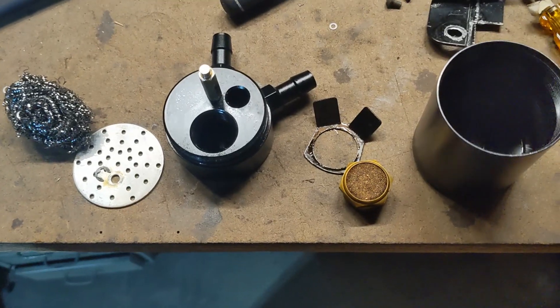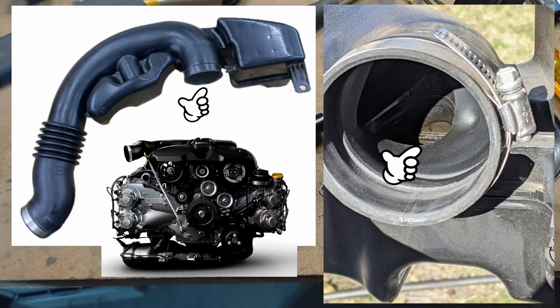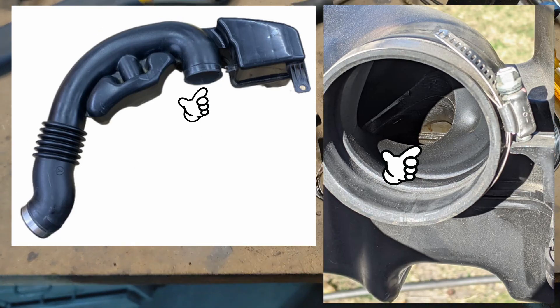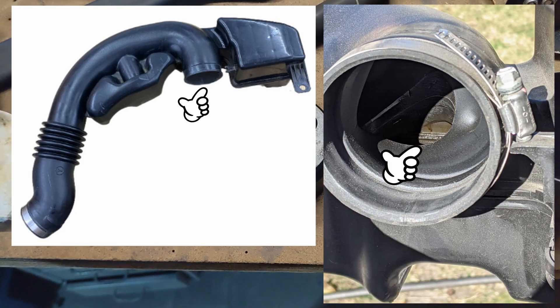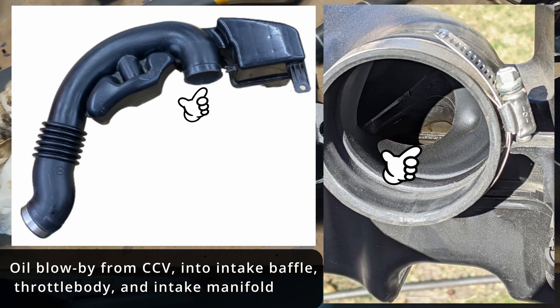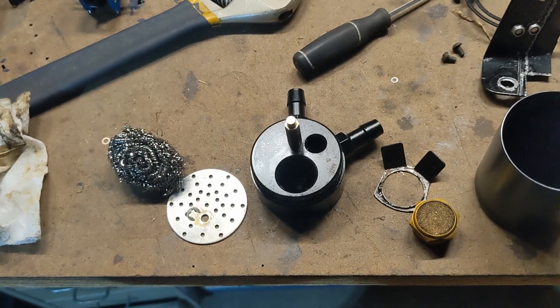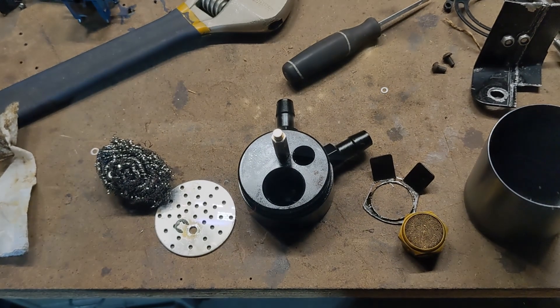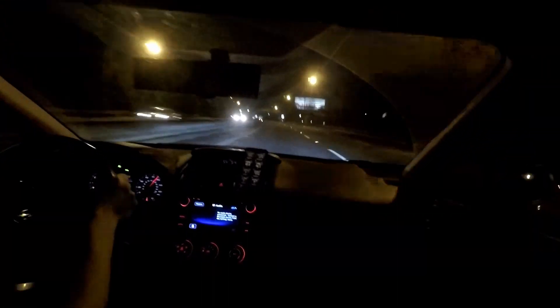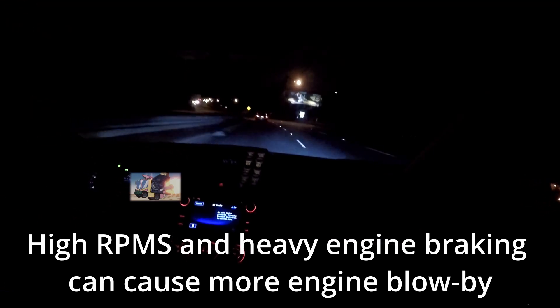Both the air oil separator and this catch can keep the intake track and intake manifold cleaner of engine oil mist. The first oiling issue I ever saw with the FB20 — and I guess the FB25 — showed up at the throttle body. It got all gummed up and threw a bunch of codes about being rich or lean. The throttle body was gummed up, the mass air flow sensor was dirty, and I'm willing to bet the back side of the intake air filter was also sprayed with that mist.